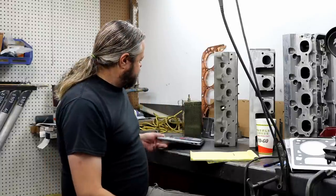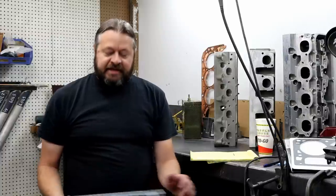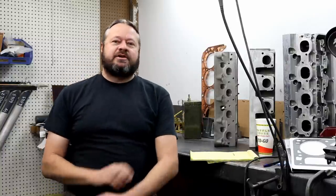When it comes to tune-ups, that can mean two different things. One is the tune-up you type in on the keyboard and send to the ECU — and it's very common for that tune-up to be the source of all your problems, blowing head gaskets and whatever. That's one type of tune-up. The other type is what the motor's actually seeing — the motor doesn't care what you typed in, it knows what the fuel injection actually does. Just because you told the fuel injection to do one thing doesn't necessarily mean that's what happened, and it's very important for people to understand this.